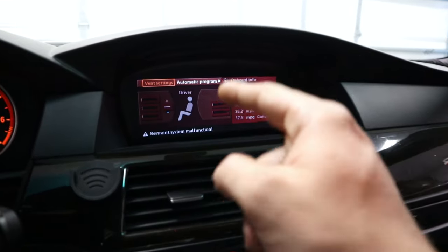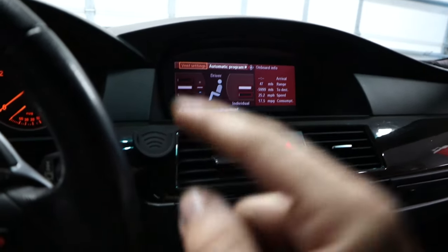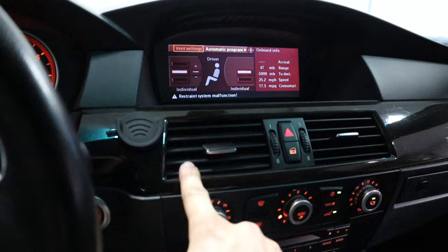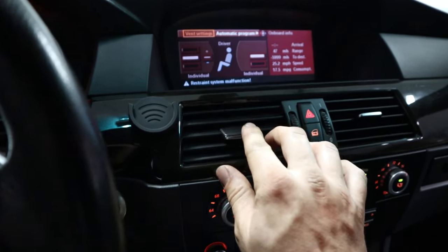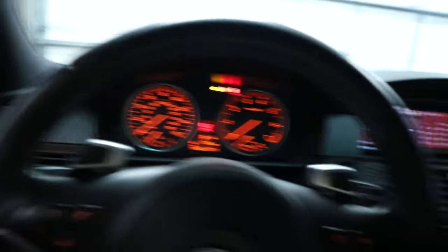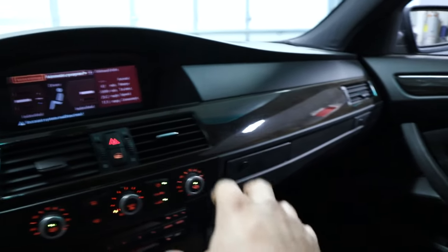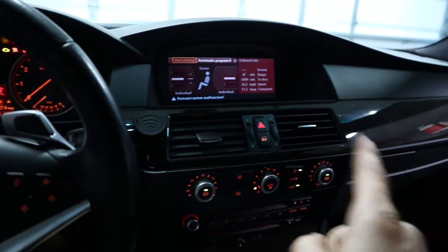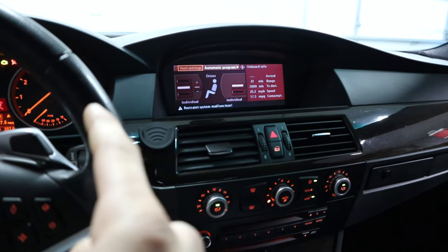That's exactly why when I do have the AC on I just have it set to use these vents here, but even then when the car gets warm I notice that this vent here for the driver spits out warm air from the bottom and cold air from the top — kind of lukewarm air — and the passenger side actually has much cooler air conditioning. That tells me that the heater changeover valve that directs the coolant from one side to the other is what's failed.